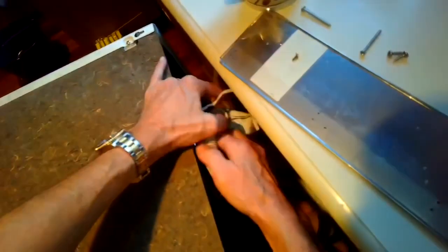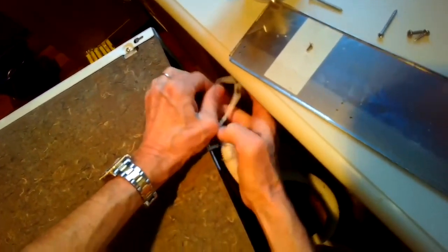And then once you get those on, you want to put the little plates back on those feet. And they only go on a certain way. You put on the back one first, then the front one. You bolt those in position. And then we're just going to carefully tilt up the dishwasher back up. Take your time here. We'll line it up inside the cabinet and then gently push it all the way back into position. You can then test it to make sure that the F14 error has gone away.